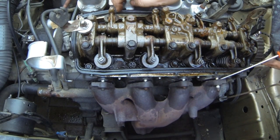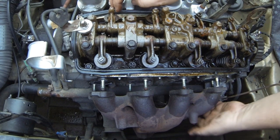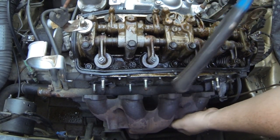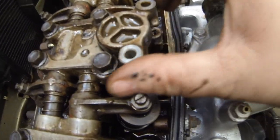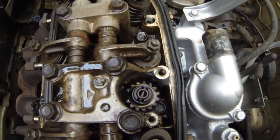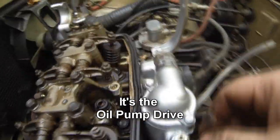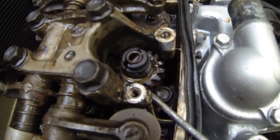A little bit of a lever - there we go. Happy days. That should come straight off and drop down. I need a bigger lever - maybe the hammer handle can go in there to lever it off. That's off now. When the gasket comes off - there's one there as you can see, and I can't get a socket on that, so I've had to take out the two bolts there. This then should lift up, which it does, and come off. And this is some sort of gear being driven off the camshaft - looks like a worm gear by the looks of it. So now hopefully I should be able to lift that gear out. That shaft goes right down into the engine into a little spline at the end. Now I've got full access to that head bolt.